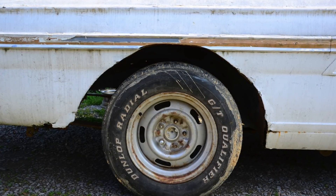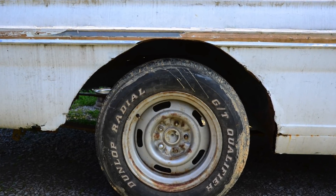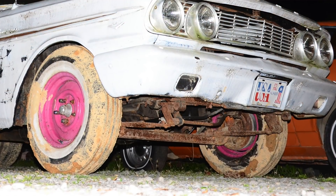Those were clean tires when they were taken down there, but by the time they got home this thing was filthy. As we pulled it home, you can see it's got Chevy rallies on the back, because this car has a GM 12-bolt rear end under it — which is kind of an odd choice because Ford has the 9-inch, and that's the go-to rear end for almost any drag car. Further investigation also found they had put a Ford Econoline front axle under it.